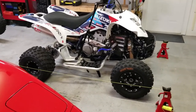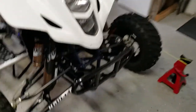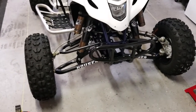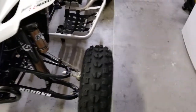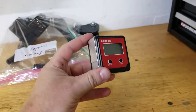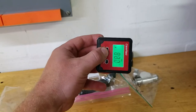You're in the dirt and sand, so your tread is going to be fine, but you do want it to track straight. If you have a caster adjustment, adjust that first. For camber, you can use a level, a straight edge, or a plumb bob. There's a really helpful magnetic tool on Amazon for about 10 to 15 bucks that gives you your degrees — you just stick it to the hub or wherever.